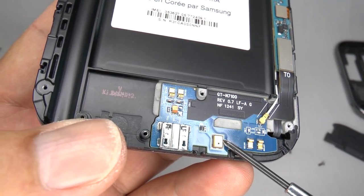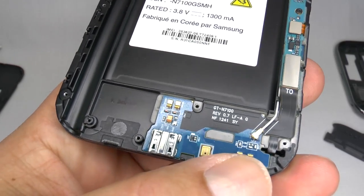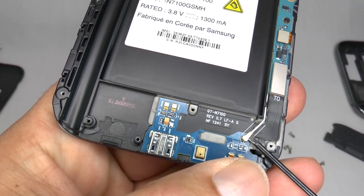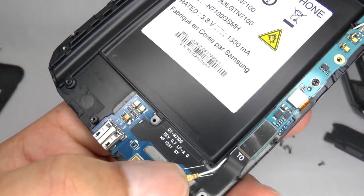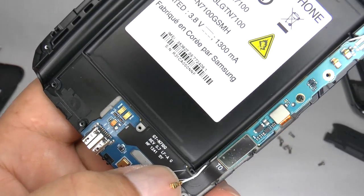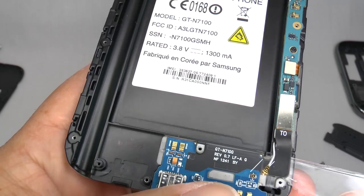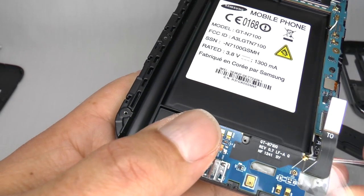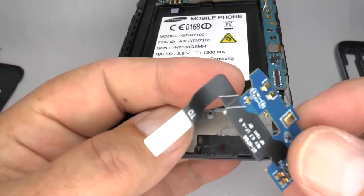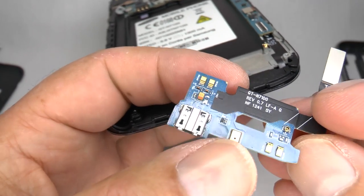If you're having trouble with your microphone or your micro USB socket, you can replace this board at the bottom. So we need to disconnect the antenna flex — just gently ease that up, try not to put too much strain on it and that will pop open. Now we can lift the ribbon connector up using your fingernail or a plastic tool. Just gently lift it up and there's a little bit of double sided tape holding this on — just gently insert a thin blade and that will lift away. This contains connections for your loudspeaker and your antenna and they should be easy to find online.